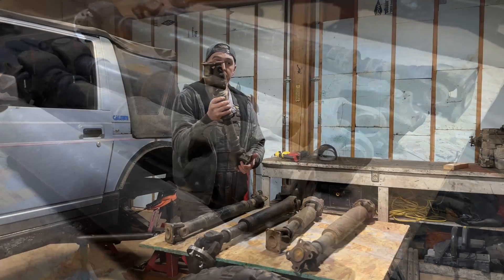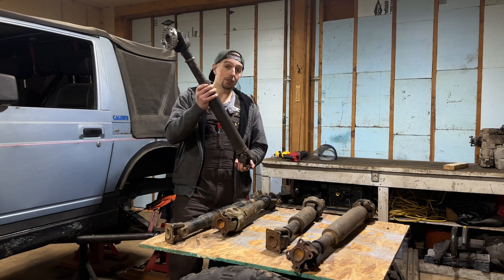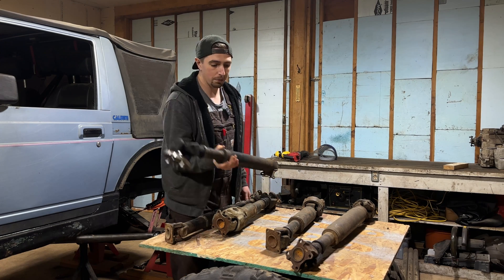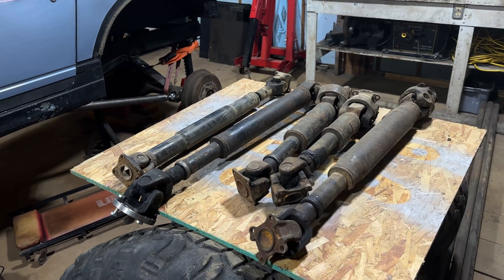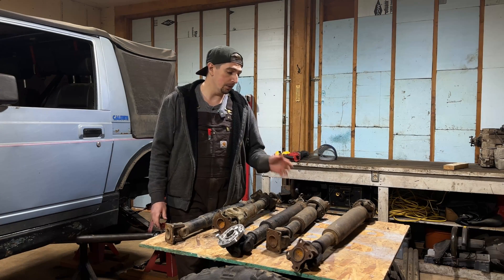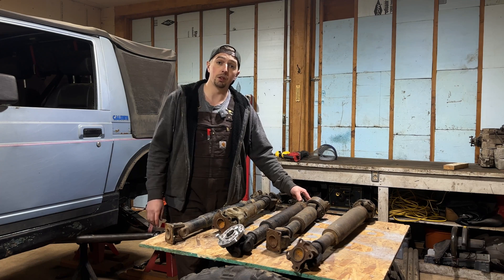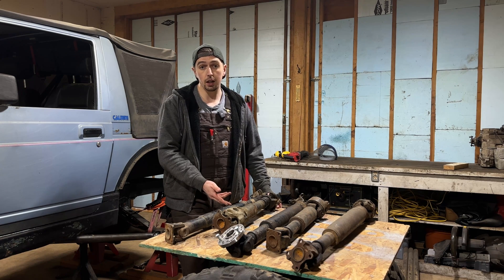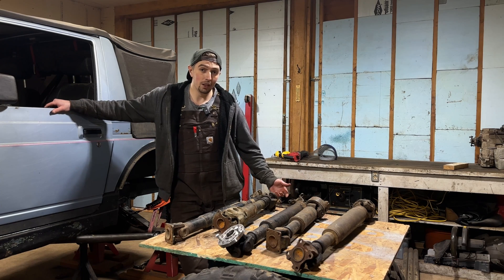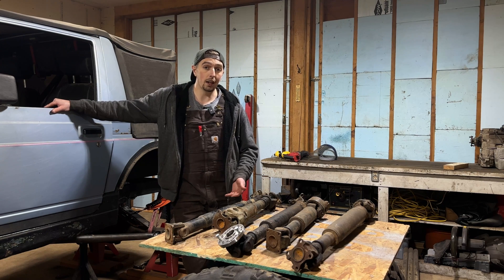I also have a variety of different lengths and joint types. This is a double cardan style Toyota driveline out of an IFS Toyota pickup, and then this one is a first gen Toyota pickup with single U-joints. Why would you use one or the other? It really comes down to your pinion angles. With a double cardan shaft, the pinion needs to be pointing directly up towards your T-case. With a single U-joint driveshaft, the angles for your pinion and transfer case need to be parallel. I'm not going to go deep into driveline geometry because there's so much content on YouTube and frankly I'm no expert — I'm consuming that information and trying to apply it to this project.